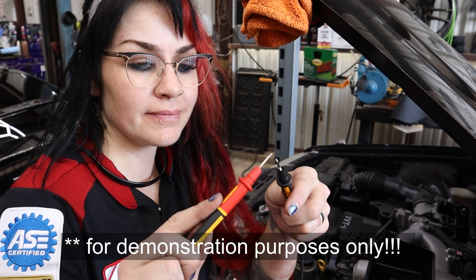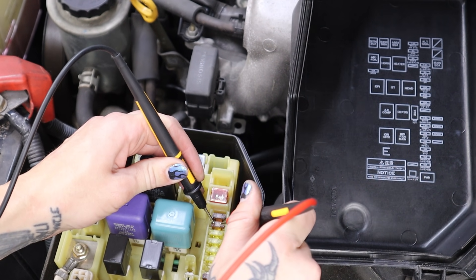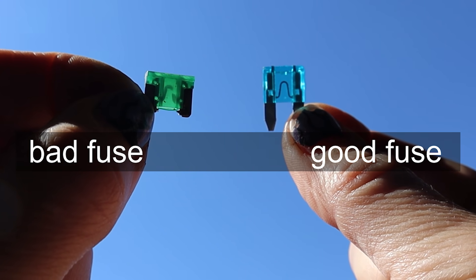In this case, obviously we know that the alternator is charging a little bit because as soon as I rev up those lights go off. But still, let's say the light doesn't go off — we're just going to use continuity mode on this fuse and just make sure that there is indeed continuity and the fuse isn't blown. If you don't have a multimeter or a voltmeter, you can also just physically remove the fuse, perform a visual inspection, hold it up to the light, and make sure it's not blown.